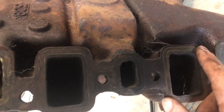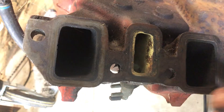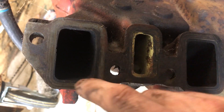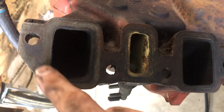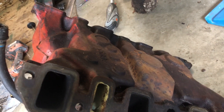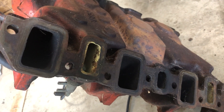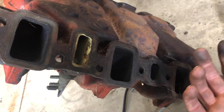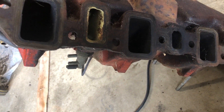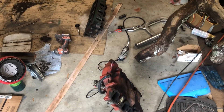This is just a really basic overview to show that you can do your own cylinder head porting with nothing more than a $40 grinder, a $15 tungsten carbide bit, and a $20 package of sanding wheels. You can really improve the state of this rough iron and clean it up a little bit — and the best part is you won't lose anything for it. You're not going to lose horsepower for having your intake ports cleaned up. You can also do the same gasket matching thing on the intake manifold. So for about $60 worth of tools, you can squeeze a couple more ponies out of your engine. I hope this was helpful to y'all — until we meet again, stay gold.